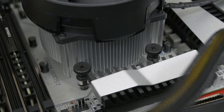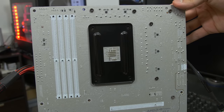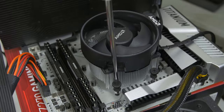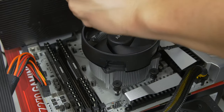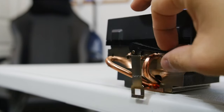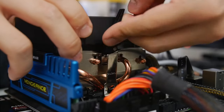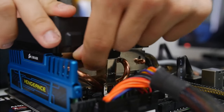The Spire actually mounts to the motherboard very easily — it probably takes 10 to 15 seconds. At first it looks like it uses pushpins like Intel stock coolers, but that's not the case. These are regular Phillips head screws that screw directly into an AM4 backplate that goes behind the PCB of the motherboard. Installation is just a breeze — super simple and straightforward. It's less awkward than the pushpins on the Intel side, and much less awkward than the seesaw retention bar found on older AMD coolers and also the Wraith coolers.